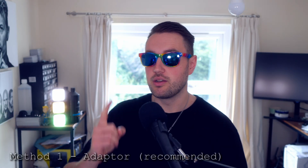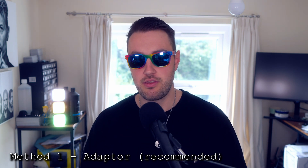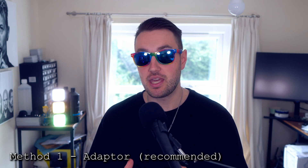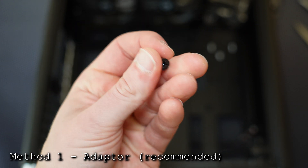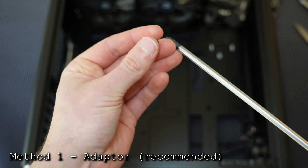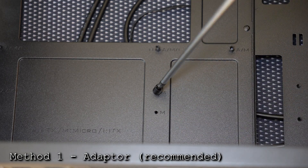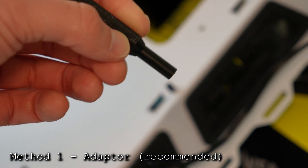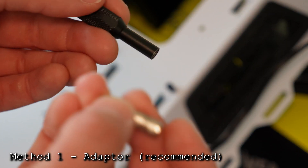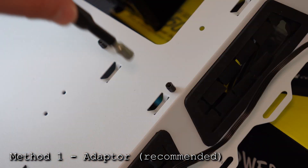So that's why we're doing it — but what about how? We've got two methods. Method one is the proper way with the least chance of damage to your case, and it uses a standoff adapter. Some cases come with a small adapter like this that can be used with a simple screwdriver. To remove a standoff, simply place the adapter over the top and unscrew. If your case doesn't include one — and most don't — you'll need an iFixit kit like the iFixit Mako, linked in the description. Use the attachment over the top of the standoff and unscrew. Easy.